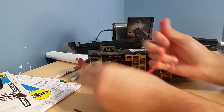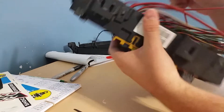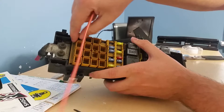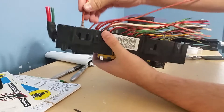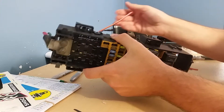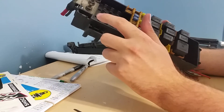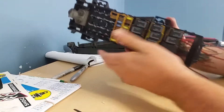Taking those out gave me a great piece of wire to strip and connect whatever I wanted. When putting them back in, your box in the Jeep needs to look like this. These won't slide back in when the yellow piece is here — it gets caught. So I took the fuses out, took this out on the Jeep, and was able to put it back in where it clicks and locks into place. The four empty fuses I had on my Jeep I put into those spots, so now I have fused wires coming out. All these are powered from the battery on one bus.